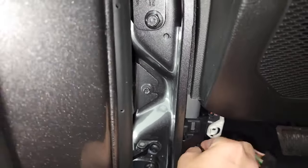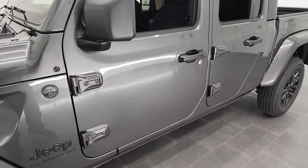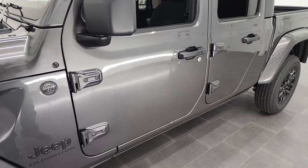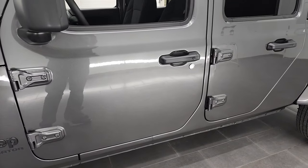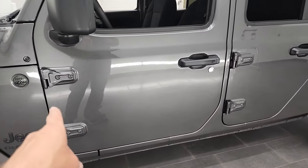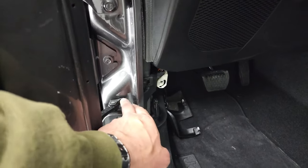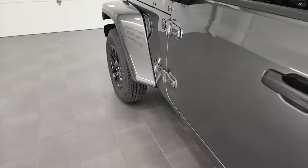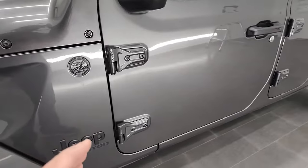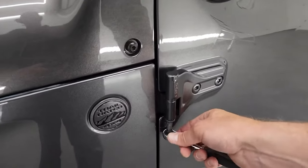Now that you've done that, you can bring the door in a little bit and get the safety strap off. The first thing I recommend doing before you take the inside brace off — now that we have our wiring harness disconnected and the strap disconnected — is to take these bolts on the doors off first. It's a procedural thing: it's easier taking these bolts out when the doors are closed. There's a brace that you need to disconnect on the front doors and you cannot let it go back into the door, because you're going to have a heck of a time trying to get it reattached when you put your doors back on.